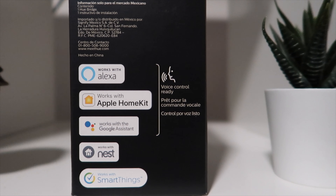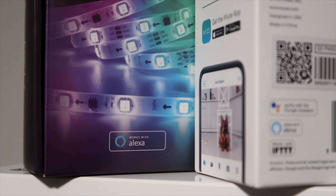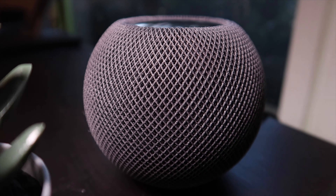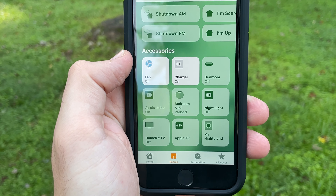There are a couple of things that you're going to need in order for everything in your house to work together. You will first need a HomeKit compatible smart device, and this is any device that has the 'Works with Apple HomeKit' symbol on their product box. You can get devices that don't have this symbol to work with HomeKit, but that process is a little bit complicated and that's for a whole different video. The second thing you will need is a HomeKit hub, which can either be an Apple TV, a HomePod, HomePod mini, or an iPad. Automations are run on your HomeKit hub and also allow you to control or see the status of your devices from anywhere.